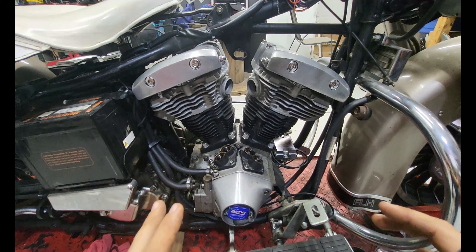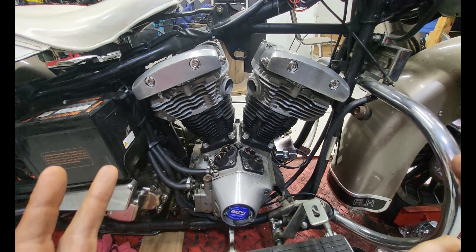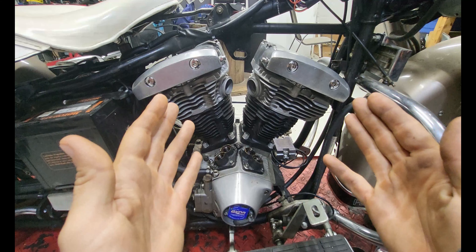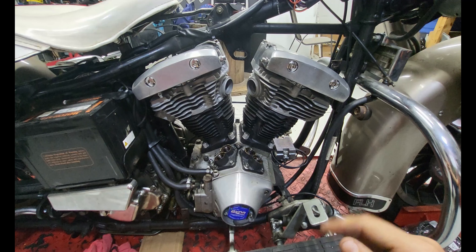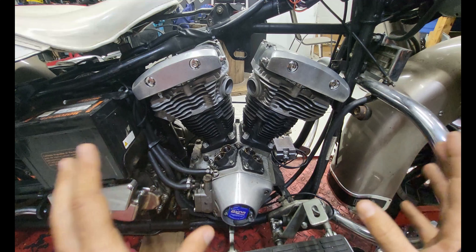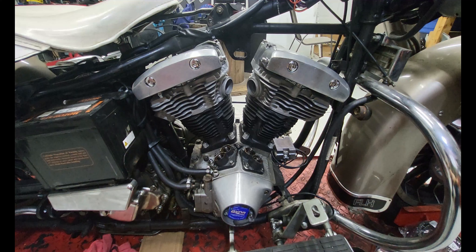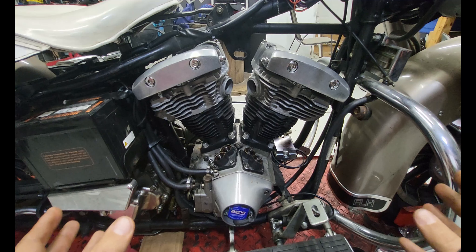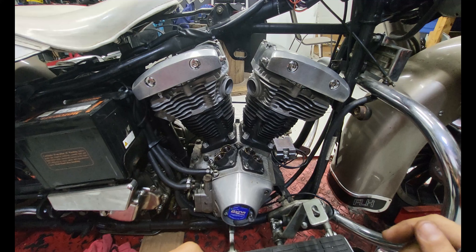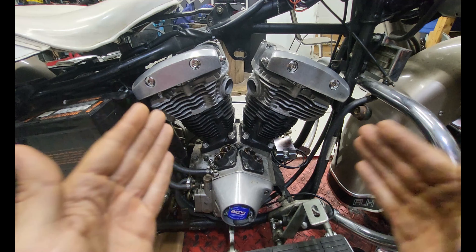We drug it out of the shop, I got it running and it smoked like a sieve - it killed mosquitoes for miles. Great if that's what you wanted to do, but it was unrideable. The reason was the valve guides and seals were shot. So I sent these heads off here recently. This sat for three years, but I sent these heads off to what I consider the best Shovelhead machinist, who's Leo, who owns Full Blast Engineering in Sioux Falls, South Dakota.